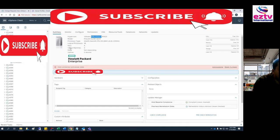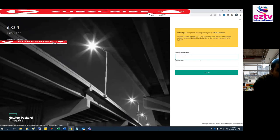But I have a plan. I will not apply the firmware update through this console, because if you log in there and start the upgrade process and somebody else logs in, they will take the priority. Your job will be postponed and their job will start, so you have to start it again. You don't know who's going to log in there. Maybe it's from your team or maybe another team. Somebody can log in anytime, right? If everybody has access, they can log in. You don't know who's going to log in and at what time. That's why I always recommend a different approach.